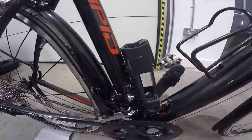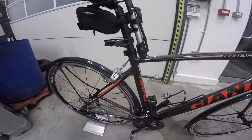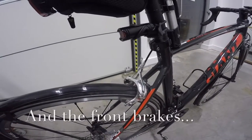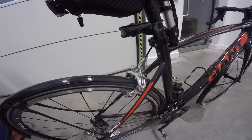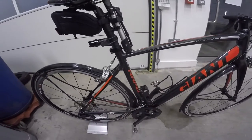All the bracketry for the front mech was fine. The only other thing that I came up against is that these rear brakes, which are the Tektro ones that came, they're what's called long drop. I didn't even know that there was any difference in brakes, but the 105 ones that I got with the kit don't actually work, which took me ages to figure out.